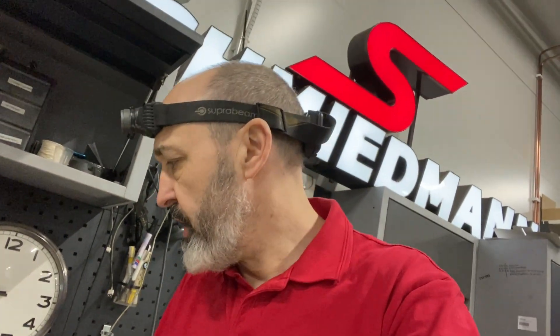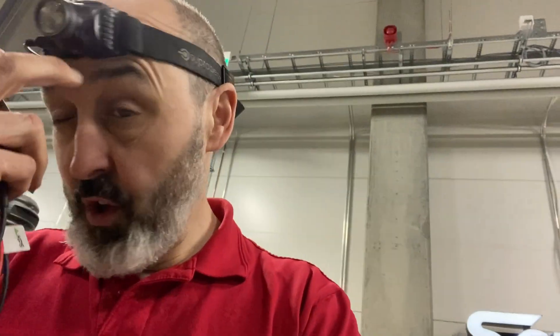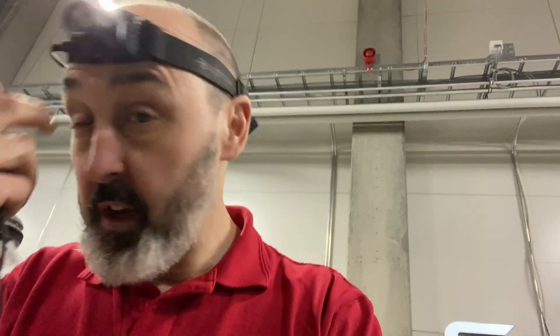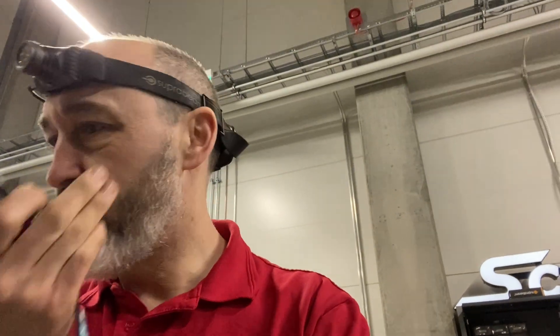Just about injectors - because on these, as I said, transistors go. Now basically it's a dead easy quick check: we're just going to get the multimeter and check the transistor - both parts of the electrical connector to ground with continuity. Usually if you've got a knackered one it'll have continuity to ground. If the transistor's gone, it's a quick easy check, no scopes needed. If there's no obvious shorts and the resistance values on the transistors are okay, we'll pull the plugs out.